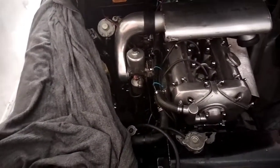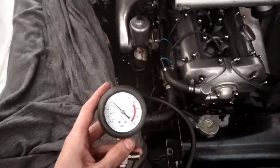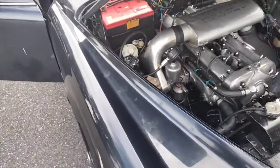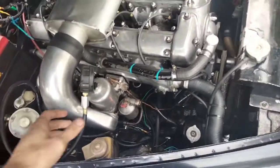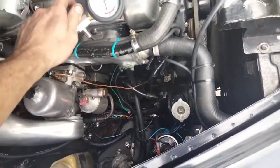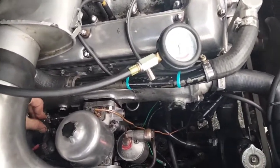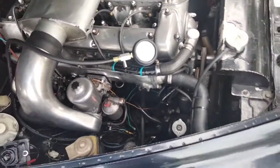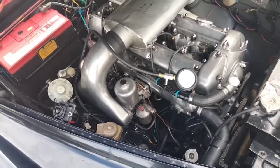Got it back together — a little embarrassing, but sounding really good. We're cold, about 50 psi. I'll leave it idling here until I can take it off the axle stands, then go park it around the corner and see what it looks like. Aside from the horrific noise the power steering pump is making — because it's running low on fluid, it's pumping air — we're actually getting better oil pressure than before. It's idling now at about 38 psi, and when you rev it, it comes up to about 45-50 psi, and I suspect that's where the relief valve is set to open. Idling at 40 — that's not half bad.